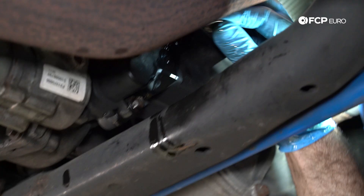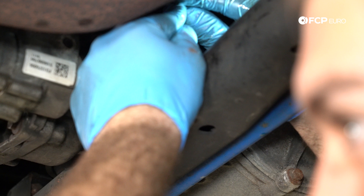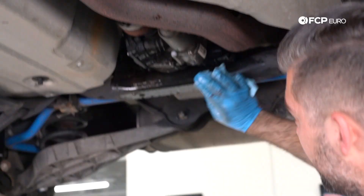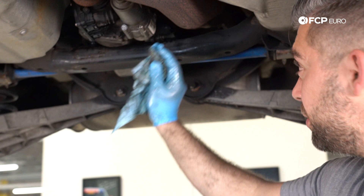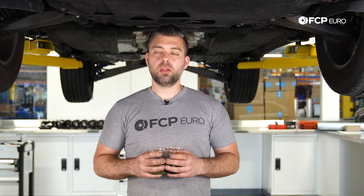Take your new drain plug, put it in, grab your favorite coin, and twist it back into location. There's actually a stop on this — you'll see it — so you can't over-tighten it. Now that the plug's in, just take some brake cleaner and clean down the area. This way, after we run it through all the gears and bring it for a test drive, we come back — if there's any fluid on here, you know you have a leak somewhere. You just want to keep a clean machine after you're done.